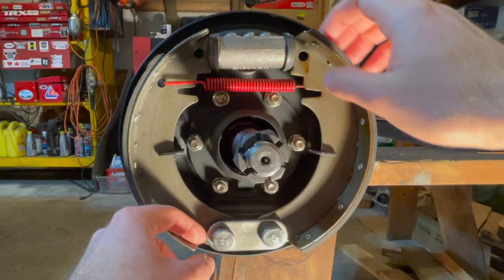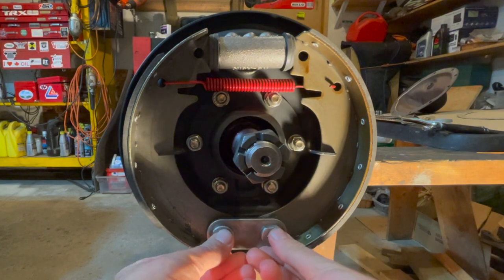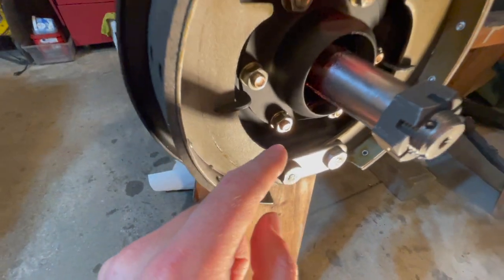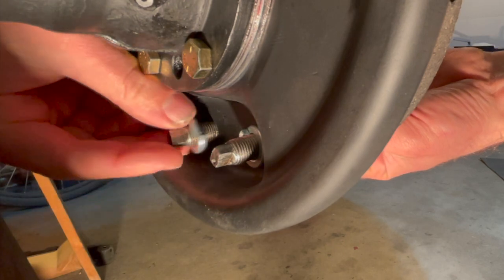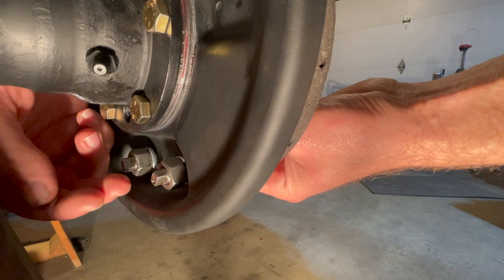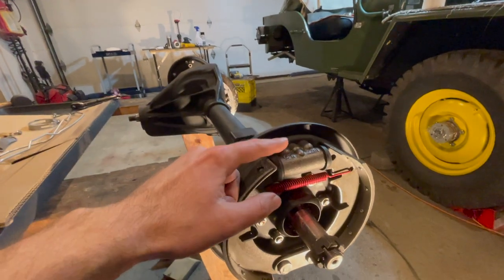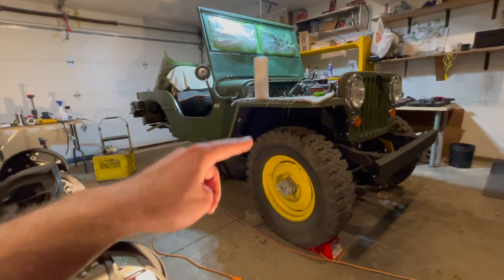You may need to wiggle the brake shoes and anchors until the assembly seats flat. Once the retainer plate and two anchor pins are flat against the brake shoe on both sides and the brass cam is seated properly, move to the back side of the brake assembly. Slide on the two half inch lock washers on both lower anchor pins, then install the two half inch fine thread nuts on both. Only thread the nuts until hand tight as further adjustments for the brake pads will be needed later using these two anchor pins. The driver side uses the exact same steps as the passenger side. For the rear Dana 41 axle, all brake assemblies are the same for rear and front — just make sure in the front you have your one inch bore wheel cylinder.